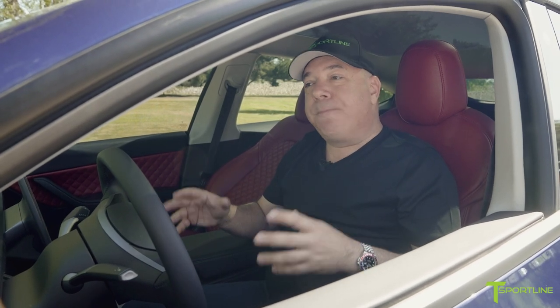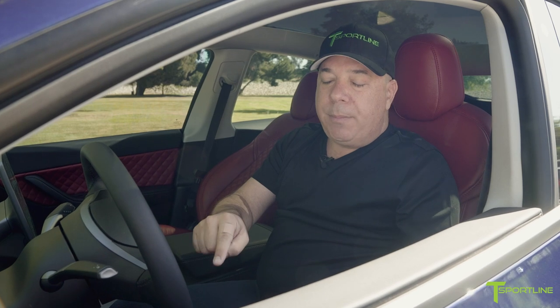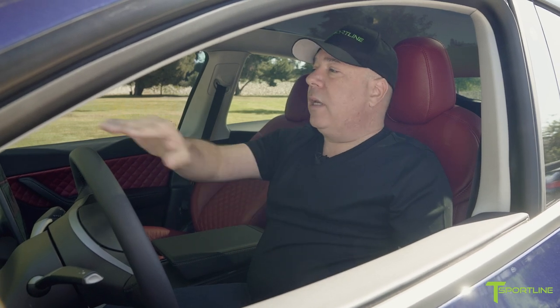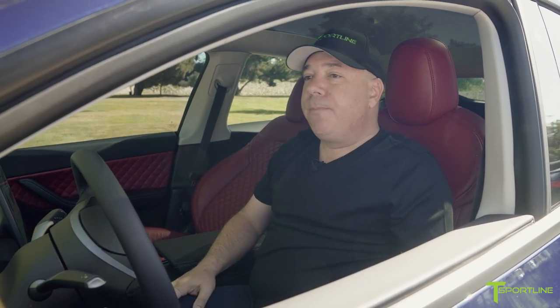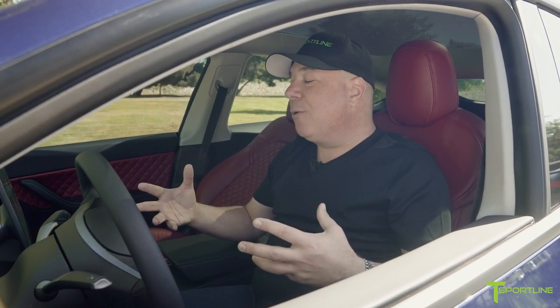The Y is the new hot car and it deserves a sound system. There are actually two packages: this is the higher-end one because it includes the 6-inch mid-range, the tweeter, and a pair of 3-inch speakers in the dash using the Focal Flax series. You can also just do the 6-inch and tweeter to save money, and keep the three factory 3-inch speakers up in the dash — it sounds just as good, just a little more to go three-way.